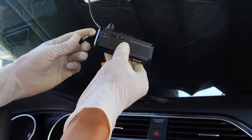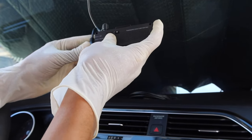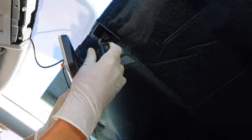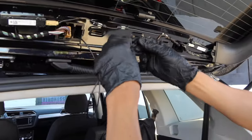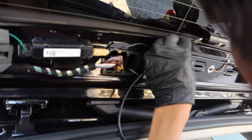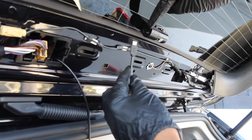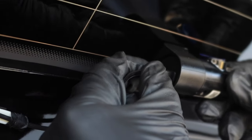Back up at the front of the car, we're connecting the cable for the rear camera to the front camera via the video-in. In a couple of minutes we'll show you the route he took to pass the cable from the front to the back of the car. Now he's connecting that same cable — plugged into the front camera — into the rear-facing camera. Notice the plug is different than the one that goes into the front camera. Now we're just securing the wires and making sure everything is tidy and well placed.